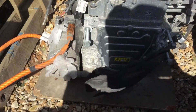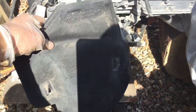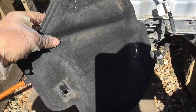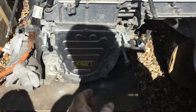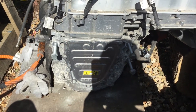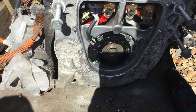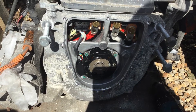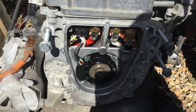Take that mount off - three 16mm hex head bolts. Take this off, we've just got those stupid little clips. Get a screwdriver, flat blade in behind them, and then prise them away. And then we get to this cover, and we have these - I think they're T30s. So we've got to take this little plate off next. And then this is what we find underneath. So we need to disconnect these connections here, which will allow us, hopefully, to pull the inverter upwards.